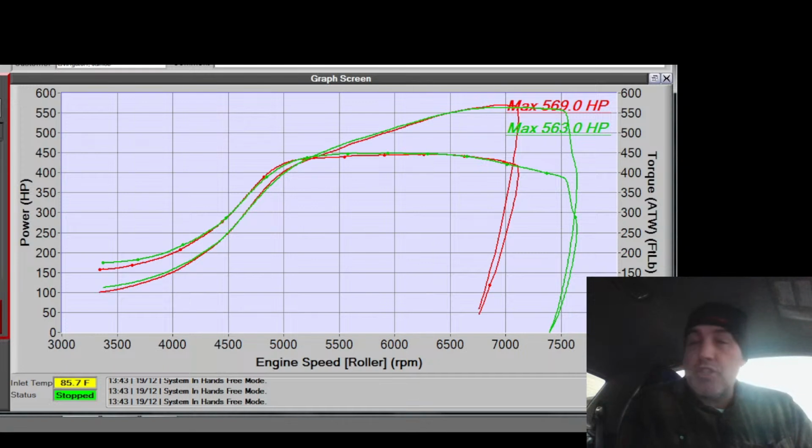The benefit of this car is it's a GD, and the GDs get way more fuel flow out of a fuel pump than the GRs, Legacies, and VAs do, because they have less restrictive fuel baskets than the GRs. That GR fuel basket is ass. You lose about 25% of the fuel pump's capacity on one of those. So you put a 340 in it, you get like 280, maybe. They're really bad. So this has got the radium dual pump hanger, which means it's going to get full pump flow, plus it's in a GD, so it gets full pump flow.